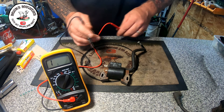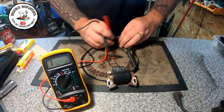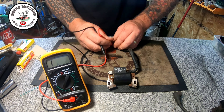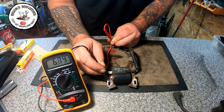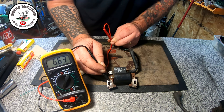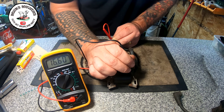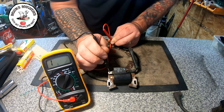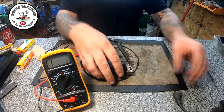This one's come off an SV150 engine, which is a Chinese-style engine commonly found on Mountfield mowers. It hasn't got a boot itself — it's got the big terminal showing. Onto the terminal: 6.66 on the HT lead. Onto the other side: 6.63 — good readings. Onto the dead man's handle terminal: 6.63. That again is a fantastic coil.